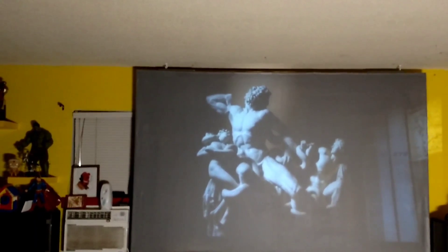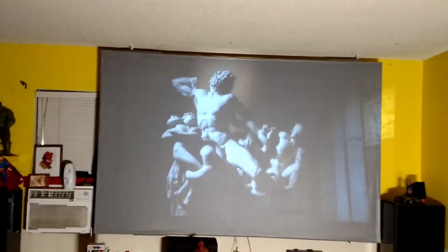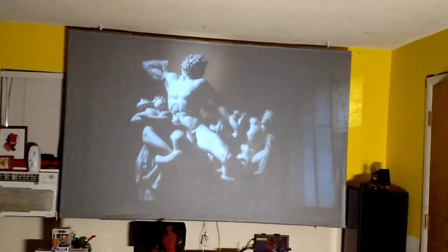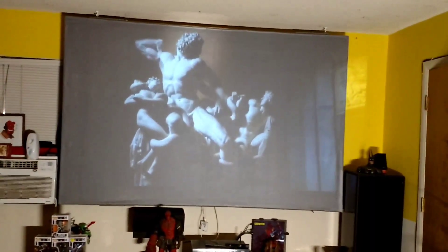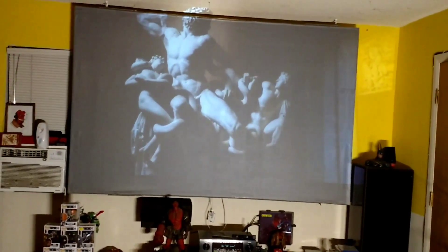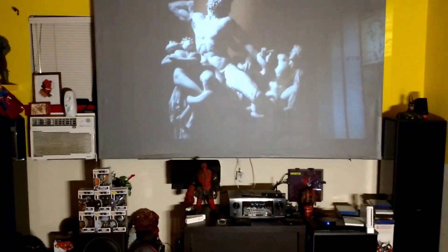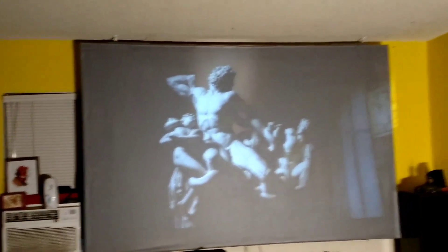Right now I have my projector 16 feet back. I can make the image bigger, it's up to you. Good advice for all you churches out there trying to get the best picture: try to get the most lumens out of your projector by getting it as close as you can, then just zoom out if you have the Epson. That way you get more lumens hitting the screen. I'm 16 feet back, and I do have these panel lights here — they are 7,000 lumens versus a 4,200-lumen projector.